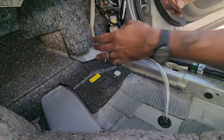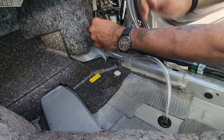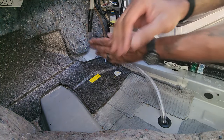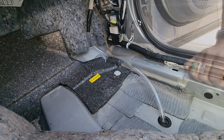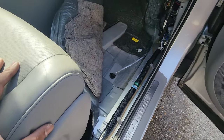I do hit it with a piece of tape, just because I'm going to put everything back together and this is all covered. If for some reason it goes to the dealer and they pull on this tube, I don't want it to easily come out. Then I pick a spot down here to route this thing, making sure it's got enough play that when the carpet's here, if somebody's stepping on it, it's just pushing it this way. Now I'm going to test it. Water from the roof is properly draining out of the vehicle instead of just into a random cavity in your car. All you have left is reassembly — put the carpet back down and you've got a proper draining system. Never have to worry about that clogging again.